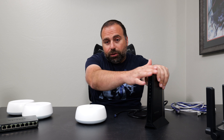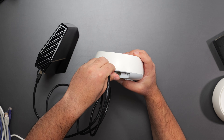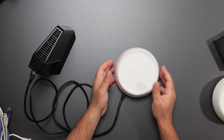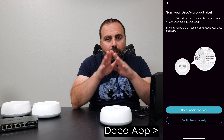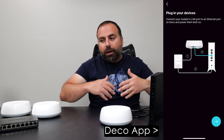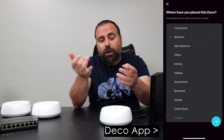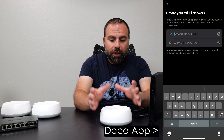So starting with just a modem, we unplug the router and connect it to the Deco. Because these are auto-sensing ports, it doesn't actually matter which one you connect to — the Deco will recognize it. After you connect this, you set it up in the Deco app and you're golden. You essentially replace your existing router and your network is back up. You can even use just one Deco, though typically when getting a mesh system you get two or more. You can use the same Wi-Fi name (SSID) and password as your old router, and your devices should automatically connect.